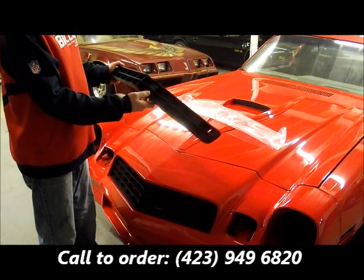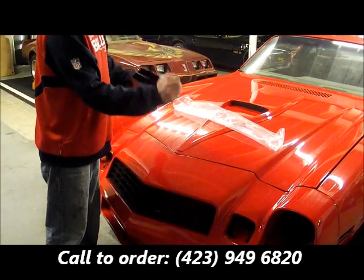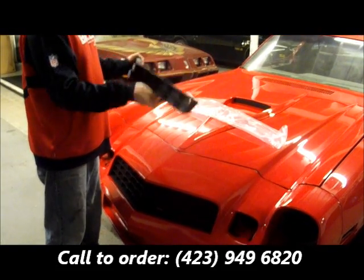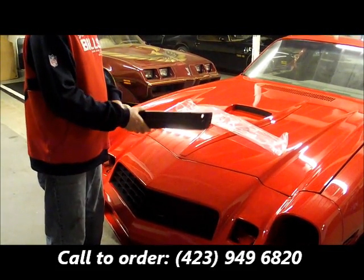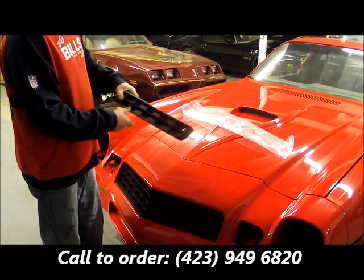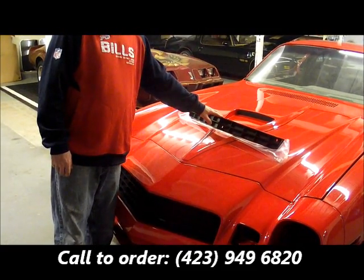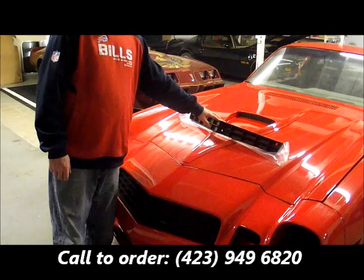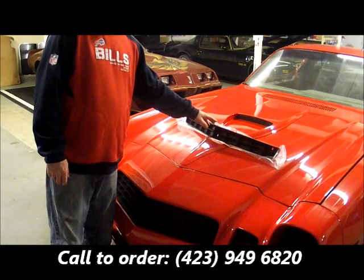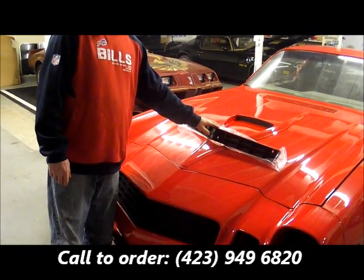This is made of the same materials as your factory GM, which means you can take the unit and twist it around like a pretzel. It's not a rigid plastic unit, and that's really nice because if your car has any kind of warp in the nose cone, this will better conform to it. This is a 78-79 lower grill. As many know, they don't make the 1980-1981 Z28 lower grill as of yet, so you can install this on your 80 and 81 Z28.